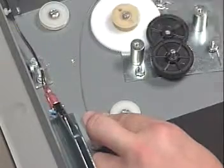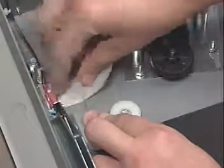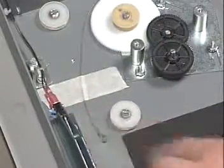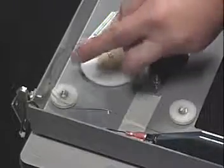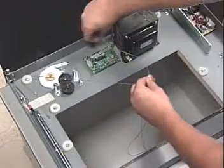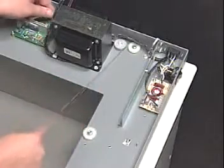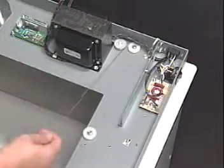Locate the new cable and identify the end which is the farthest from the ball on the cable. Tape this end to the bottom left side of the base. From here, route the cable as follows. Go clockwise around the left rear pulley, behind the shuttle board and the transformer and under the transformer leads. Clockwise around the right rear pulley, which has the large washer on top.